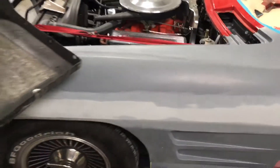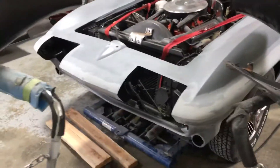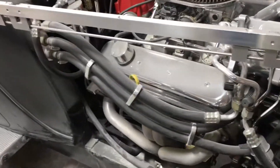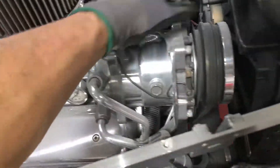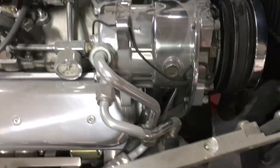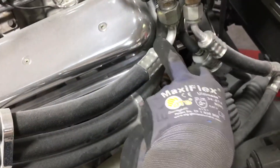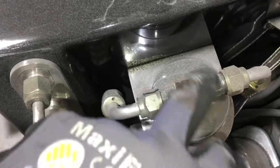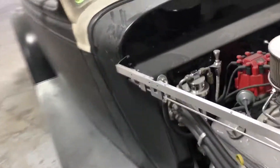Old Corvette getting restored. It looks like we have a vintage air unit on this one — got the nice chrome compressor, chrome pipes into your standard shop-made rubbers, and the chrome receiver dryer. Parallel flow condenser.